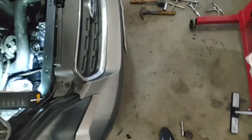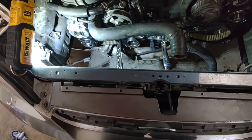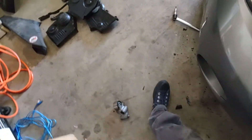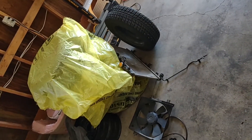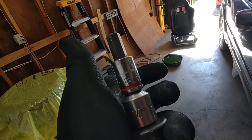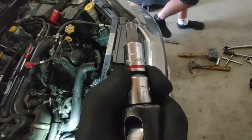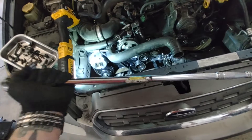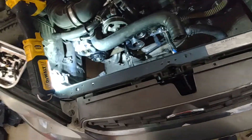Have fun with that guys — it's a lot of fun. I had some leaking cam seals and now I won't. I will say these guys are really tight. The hex to take off the cams is a number 10 Allen key. I suggest, if you don't have it in half inch — a lot of this stuff comes in three-eighths — get a half-inch to three-eighths adapter. Use a 24 inch breaker bar; the 18s suck and it will be a lot more effort. Or use an 18 and an extension of some kind, like a handle to a jack.